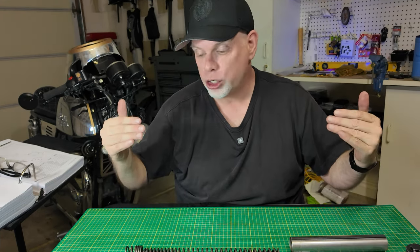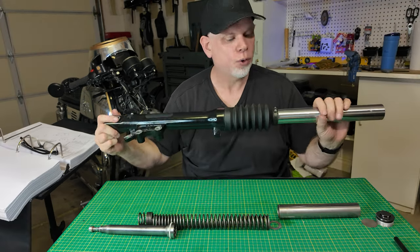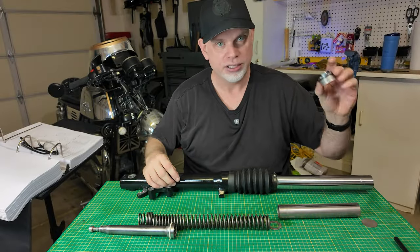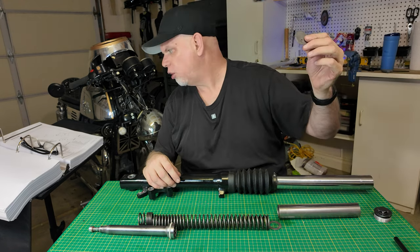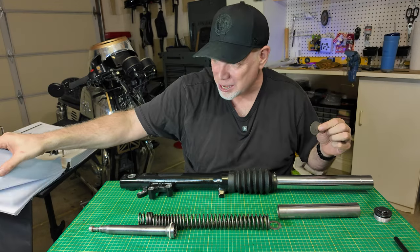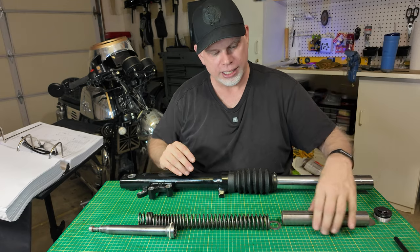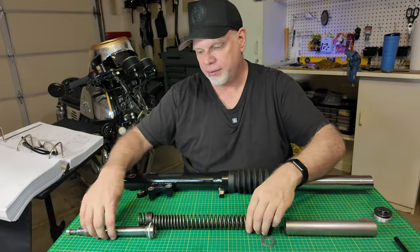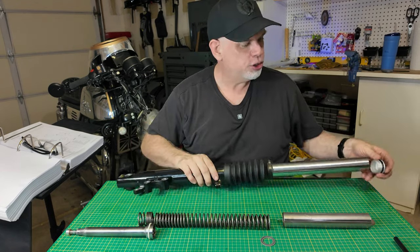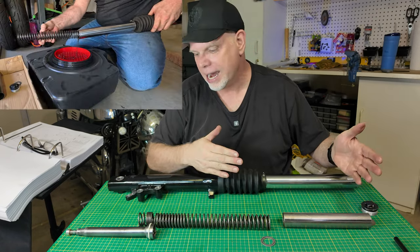First I just want to show you how you take it out and why you want to take it out and drill the hole. So this is one of the front forks, and I already have it taken apart. This is the front fork cap, this is called a washer plate. I have the manual — thick manual. This here is the spacer tube, then we have another washer, and then we have the main spring. As soon as you unscrew this top cap, all those parts come popping on out — very easy to take out.